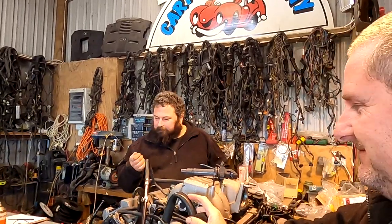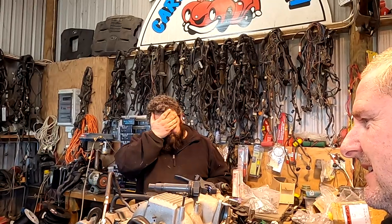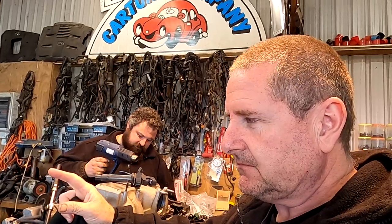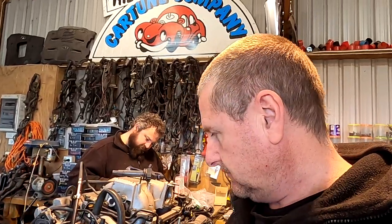He was reading the wrong numbers and it became a lucky dip situation — because this ECU is so old it doesn't get wired in cylinder order. The first cylinder in the firing order after the trigger wheel passes the sensor is what they think is cylinder number five.